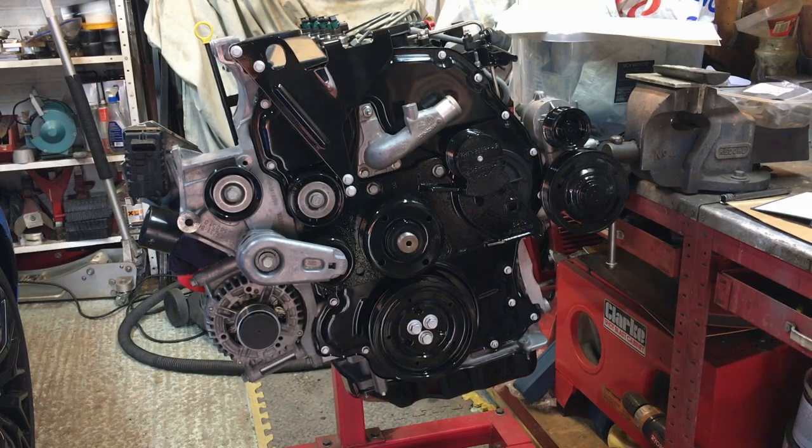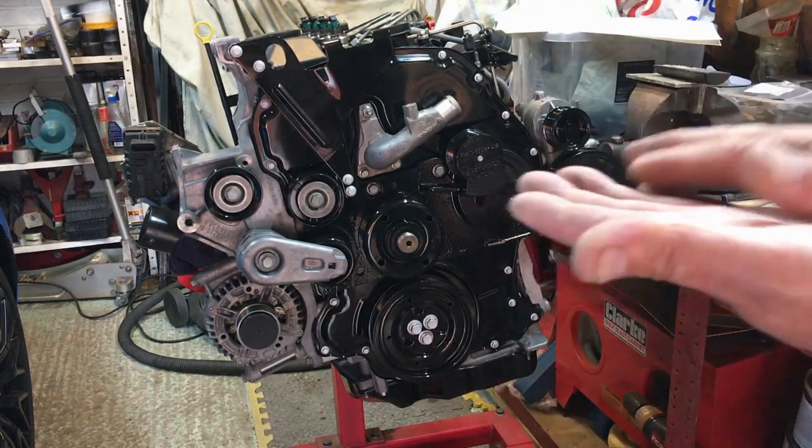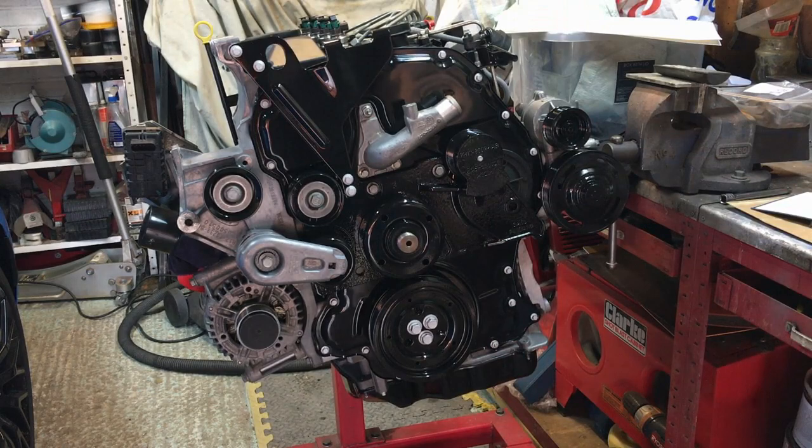It weeped before. It was actually stained with oil, but not dripping or anything. I think that gasket looks a lot better, but it's actually a very easy component to replace while it's in situ, so I'm not going to worry about it too much. If it does leak, we'll get another gasket, or do something else. Why they couldn't machine O-ring grooves in there, I do not know. You've just got flat faces, face to face, with a compressed O-ring in a gasket.